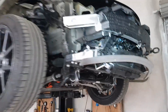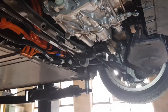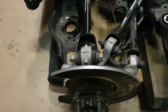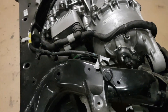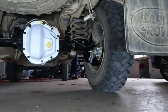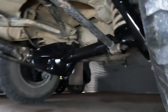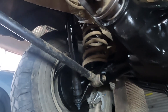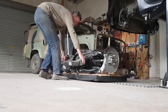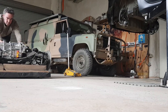The next job is emulating the front motor. Most people would think I'd use both motors to make a four-wheel drive setup in the Land Rover. The Tesla uses the rear motor for the rear wheels and the front motor for the front wheels — but that won't work here. The Tesla has independent front and rear suspension with drive units between each set of wheels, whereas the Land Rover has solid axles with a prop shaft from the transfer case. I want to keep the solid axles with the four-link suspension. So the plan is to rotate the rear Tesla motor 90 degrees so it drives both the front and rear prop shafts of the Land Rover.